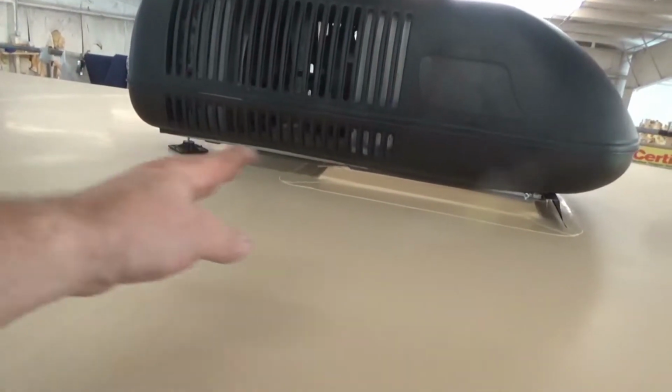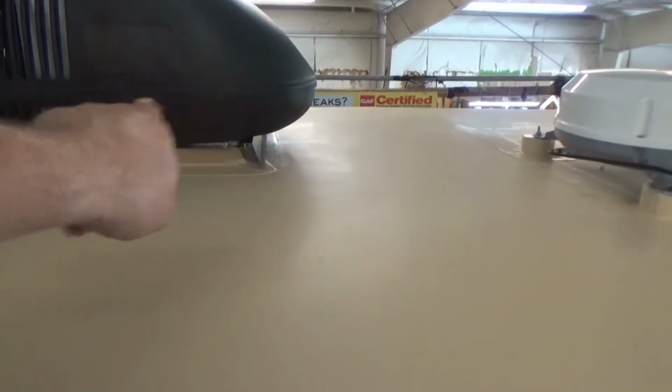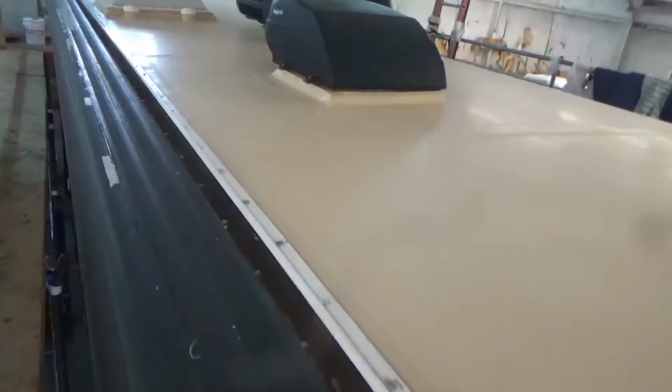So you're not going to have this water try to run along the bottom there and try to get back into that little foam gasket. But on the front, you can see the way it shapes around. I don't want water when it's raining to come in and try to get into that gasket. So that piece right there actually returns back up underneath that cover. So it'll have to hit that. It'll drool down this flashing detail we put on, and then it'll come back down this way and get away. So, that's our Providence update.